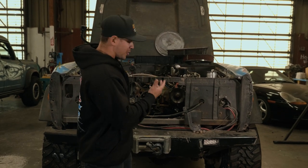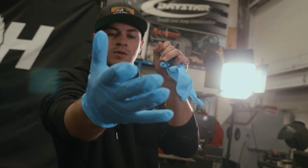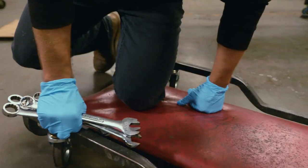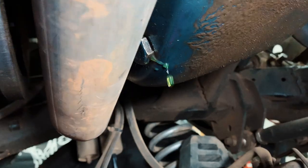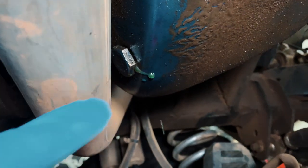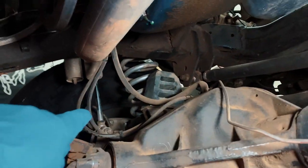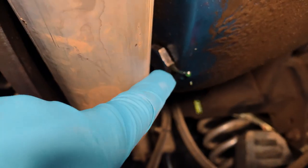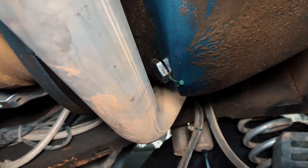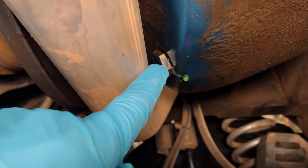It's been two months and I still haven't looked at the oil in this thing, so be my guest. That's interesting — we're only like a turn and a half on this drain plug, and we've got coolant coming out, which is fun. It probably came from opening up the water pump and the timing chain cover, so that's what I'm hoping. But if not, that was an even bigger problem than we thought. Let's get this drain plug off and see what else we've got hiding in here.